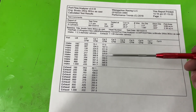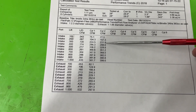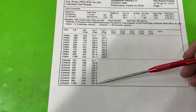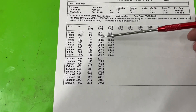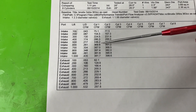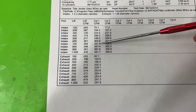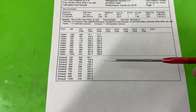The biggest thing is I'm using a different valve. The short runner is actually not that bad — 390. The exhaust is actually pretty good, partly because the Tulip exhaust valve makes numbers look a little higher. The 400 lift number is 286 and 289 — not bad. The 600 lift number is not good: 370 and 351. That's not good at all; it should be about 400. That's a little disappointing.